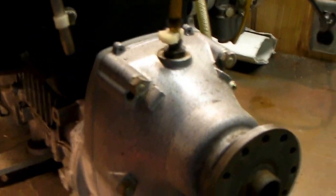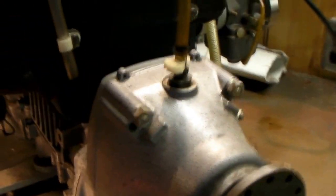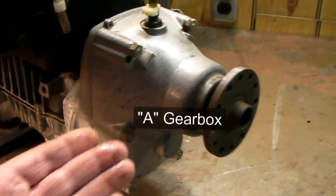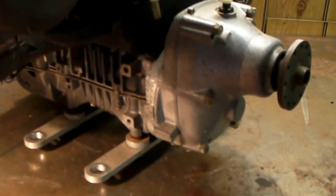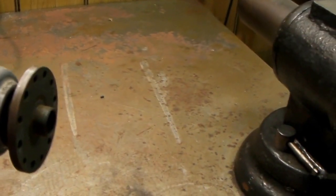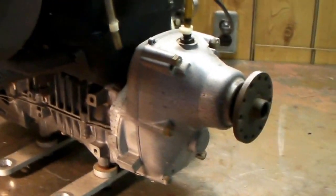The only other thing I was told about it was that the gearbox leaks, and I can see it does — there's always a little trace of gear oil coming out of this big gearbox. You can see some on my hand under there; it's oily. So I'm going to see if I can figure out where that leak is coming from. Could be a seal in here, but my guess is it might be the gasket or the drain plug, because it seems to leak even when it's not running.